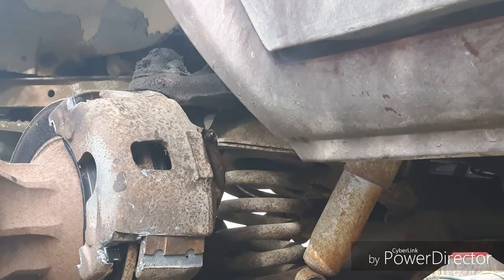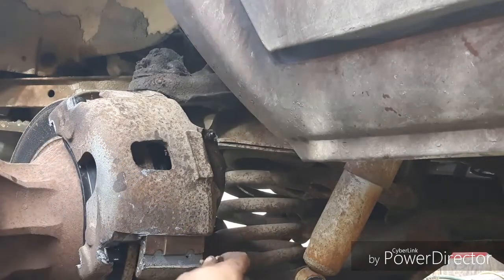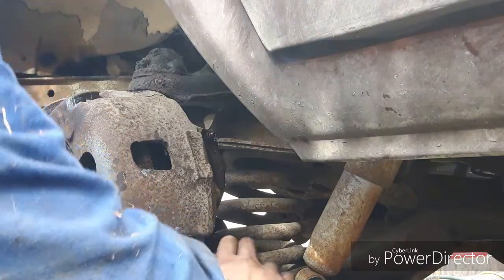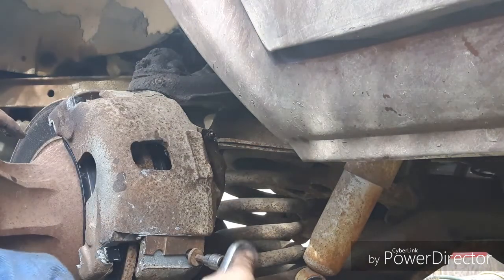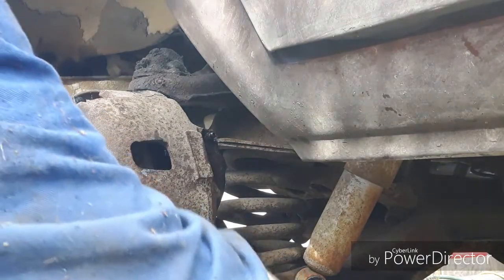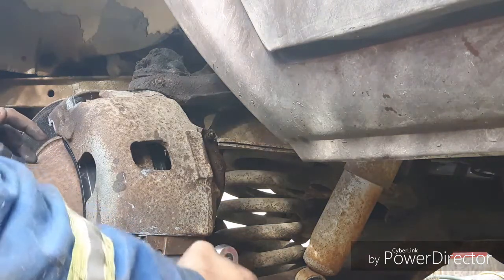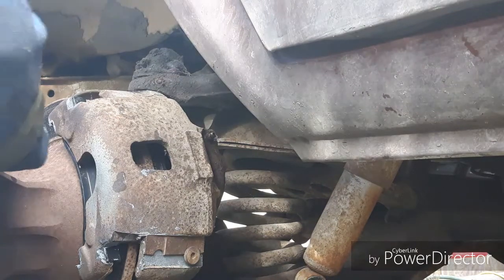Grab that. Grab our 1/4 inch Allen. Now there's a little anti-seize in these threads already, so as this threads in, that'll work its way down. So just gonna thread this in. Grab my ratchet. I'm gonna collapse the ratchet so it's not so long. And this doesn't need to be crazy tight. You don't want to shear the bolt off or anything. That would suck.